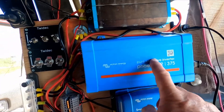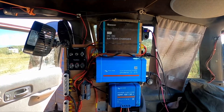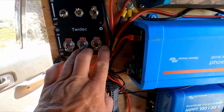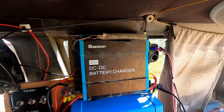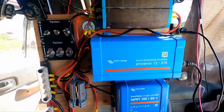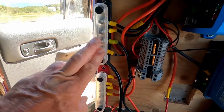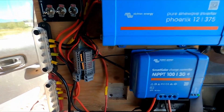So here's my inverter that I just installed. It's a little tight in my little Jeep here, which is my control panel. I added six toggle switches — three toggle switches here for three lights. I have some on my tailgate and one inside. I have a small light inside and two for outside when I'm cooking. And then I got a distribution center here — two power coming in, power going out right to the battery, and that goes off to all my other units.